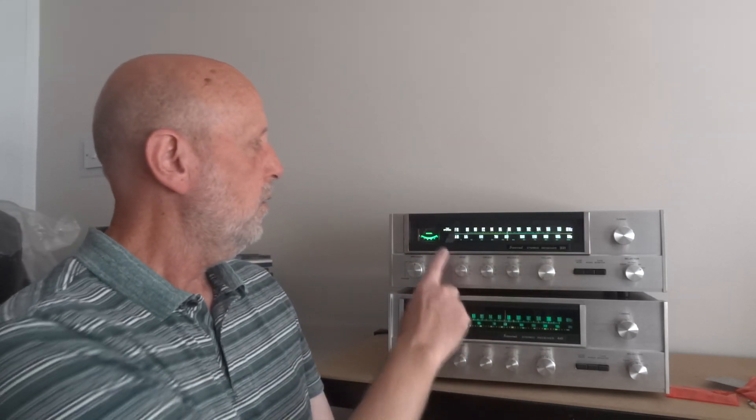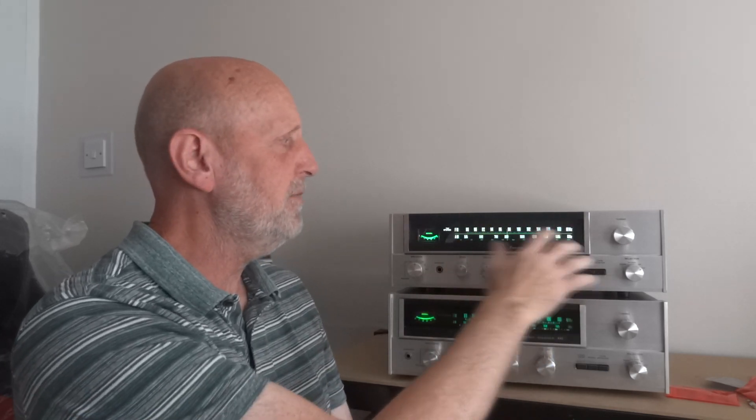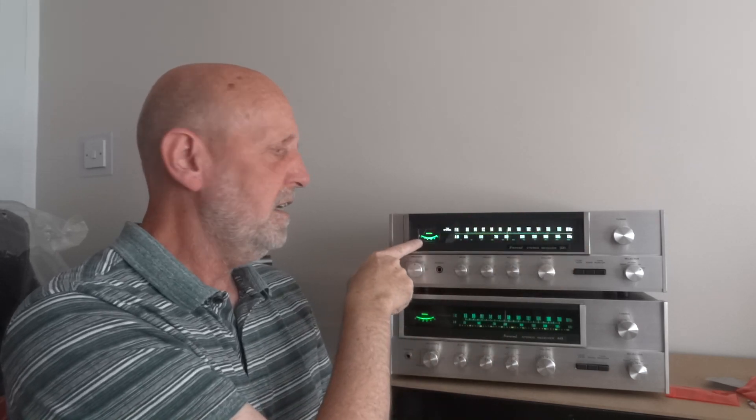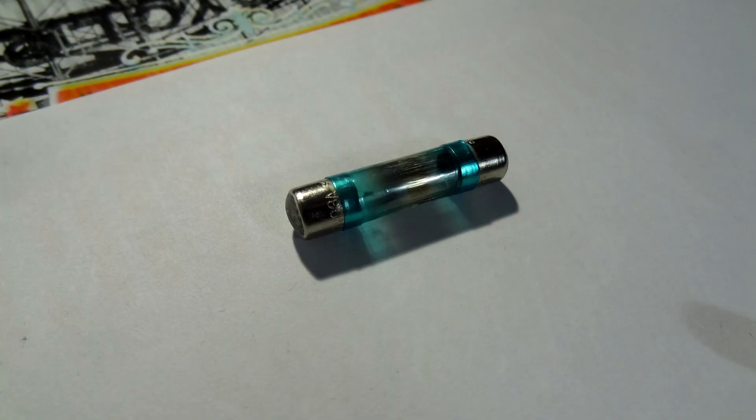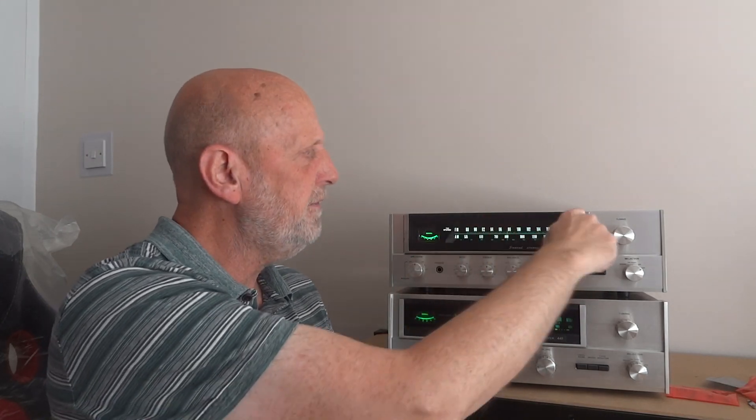One thing to consider when choosing colour — on these Marantz and Sansui units I've got over here, you might get a bulb that's got a filter over the top of it. I'm going to show a picture — this Marantz I think has got a blue filter. So the bulb, even though it's incandescently white, they tried to change it to blue. So you may want to look for a blue coloured bulb to replace that. It may have a colour filter. Or if it hasn't got a filter on the bulb, check the back of your unit — it may have a green film or some coloured film. You may want to go for that colour bulb, or just do a white one and let that film do what it's supposed to do.